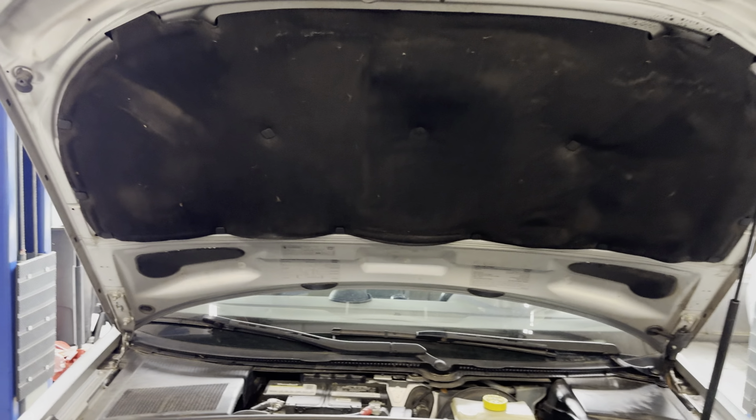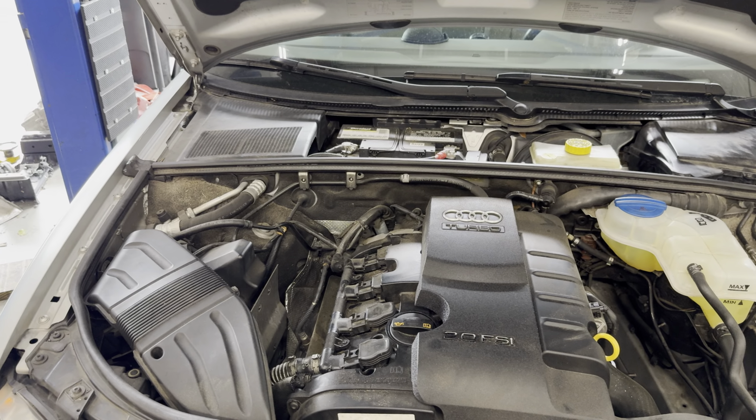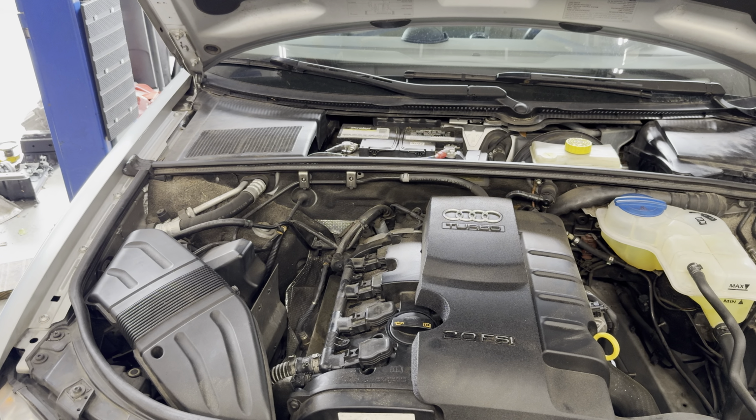So we're all the way down low enough to start the car. We're gonna go ahead and try. So far what we do know is that someone else had already put a starter on this car and they damaged the connector housing going onto the starter because the secondary lock was broken and the rubber seal seemed to be a little bit swollen. So we're definitely gonna have to have a connector housing, but also the terminal inside the starter was a little bent. So let's see if that's really all it was. So then, apparently that is all there was.